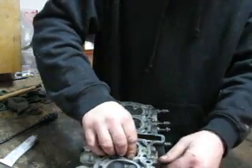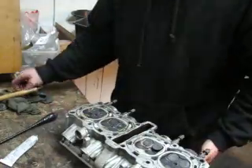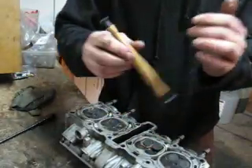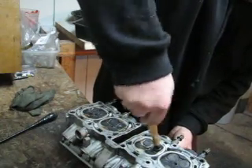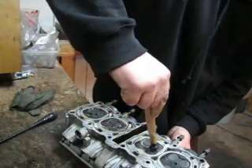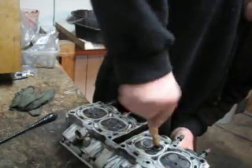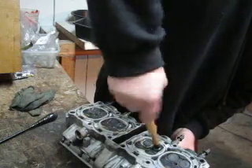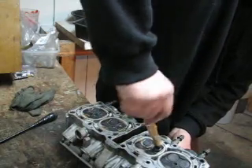That moves a lot nicer now. Hang it off the edge a little bit so I can get my finger on the end of the valve stem. It's a little tool for spinning valves — made for about $2. And you just spin it. When I spin it, I like to push the valve up a little because if you listen you can hear the grittiness of the valve grinding compound. It starts to smooth out after a few twists. But you raise it and then it gets rough again — it's a little more abrasive, which helps get the seat clean.